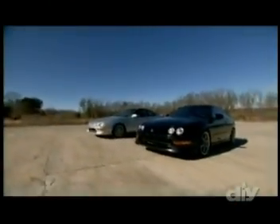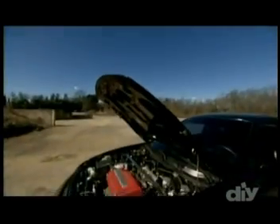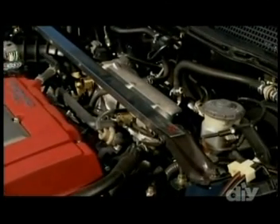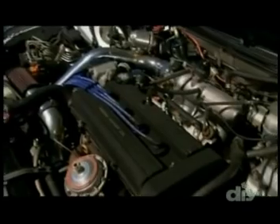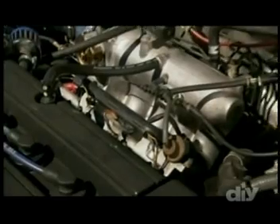The two-door Integra is a great ride to customize, but the holy grail for performance enthusiasts is the special edition Integra Type R. The factory racer has a beefed-up chassis and suspension, plus a lightweight no-frills options package. Among other upgrades, a high-volume short-runner intake manifold helps get more air into the engine, and the combined result is 195 ponies without forced induction. Many of the engine mods from the factory Type R have already found their way onto our project car, including stronger pistons, rings, rockers, and rods, so dropping in a performance intake manifold should be just what the doctor ordered.